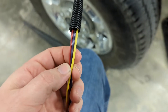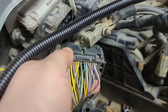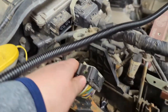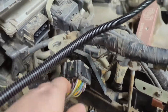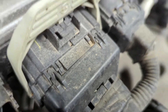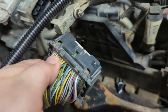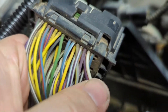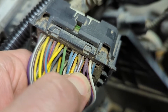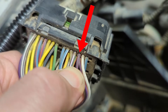The purple and the yellow each go to this body harness right here, and so this is plugged in right here normally. You take this off, take the little gray arm — it comes off first — and then there are these little spade things you can peel back to get this connector more exposed. Once you have it dissected like this, you can count in: one, two, three, four — it's this purple wire right here. It's the fourth hole in from the right — that's the one, this purple wire.